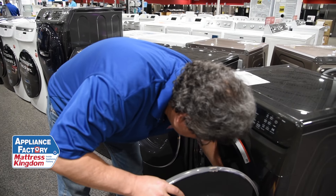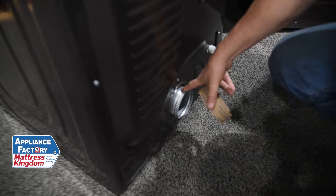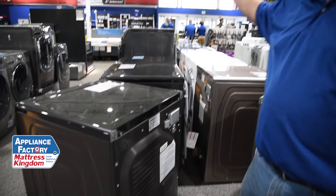The second thing you can check is your vent system. This time of year, birds and animals start building nests in your vent system. I had a customer who swore the dryer was the issue, but I pulled out a bird's nest — that's why her dryer wasn't heating. To check this, get to the back of your dryer, take off that big silver flexible duct, hit start, and let it run for a few minutes. If you can feel heat building up and it starts feeling normal, you've got a problem either in your vent or on the outside of the house.